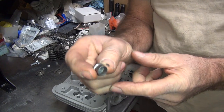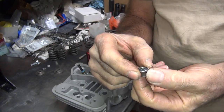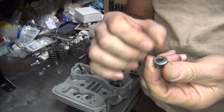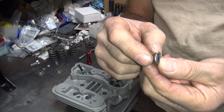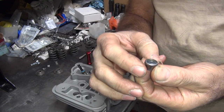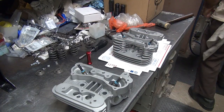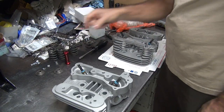These are metal seals — you beat them on until they bottom out on a steel piece on the inside, and then they work. If you really go too far you beat the whole center out and it doesn't work, but you push the inner washer in and it'll pull right off. These work pretty good — metal on metal. I put Loctite on them, they seal up and stay put. I like them for their lower profile too, so you've got more clearance. Modern stuff — supposed to be better. Debatable.